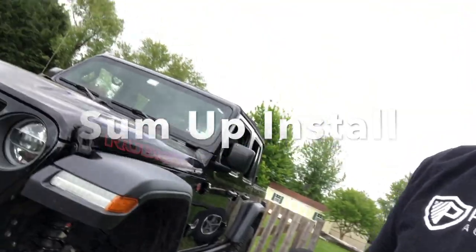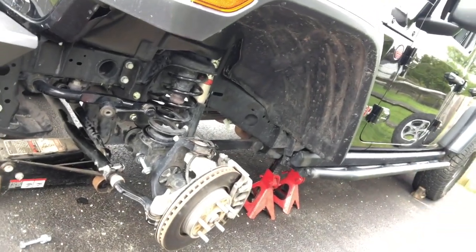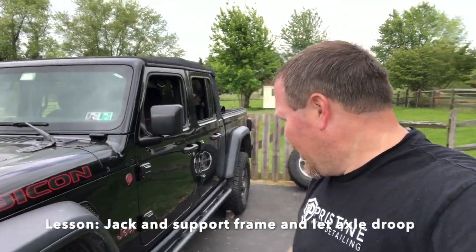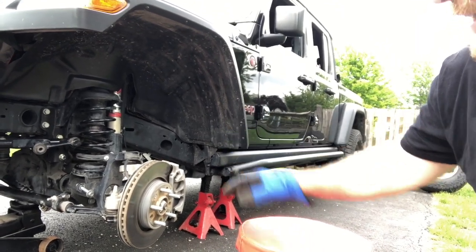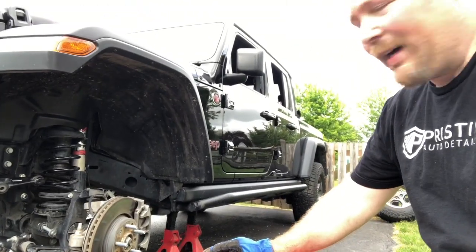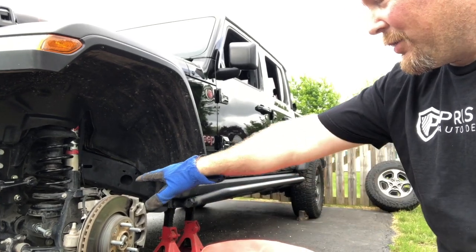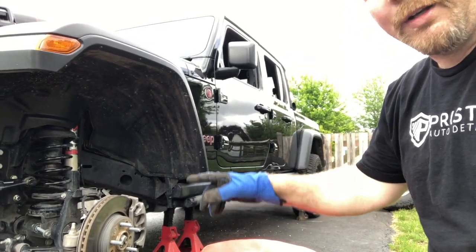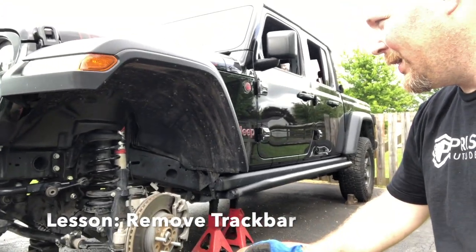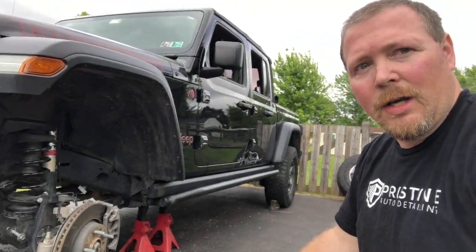Overall, kind of a medium difficulty job. I got the other side of the track bar on and we'll get the driver's side on once it's on the ground and level. A couple lessons learned: first, jack the frame up and let the axle come down — it'll give you room to work on the back side of the sector shaft. I was getting jammed up a lot. Rest it on the frame rails with jack stands for safety, with the jack under the axle. Second, remove the track bar — it's in the way and hard to get leverage. It's easier to just remove it and set it aside. One bolt, easy.